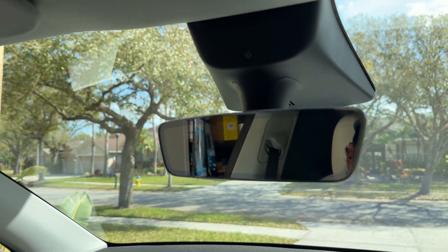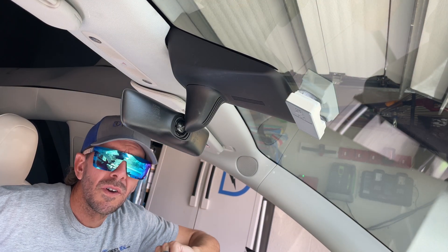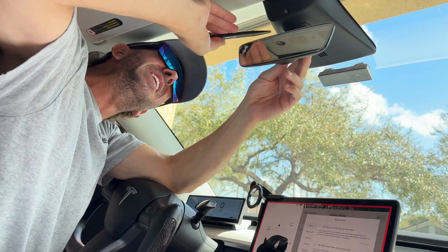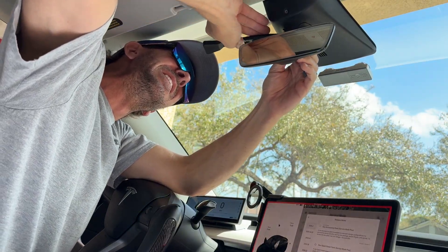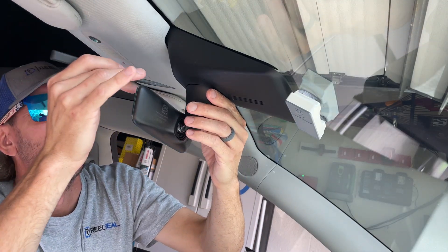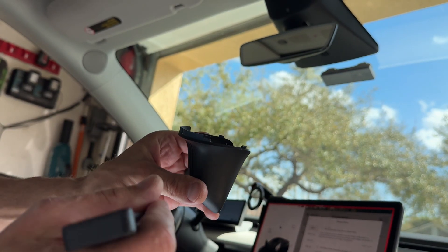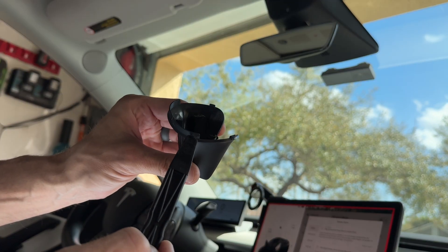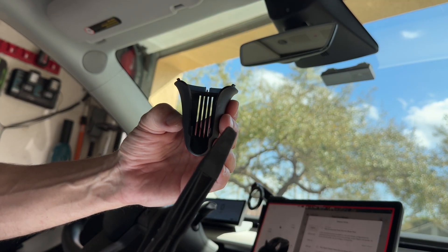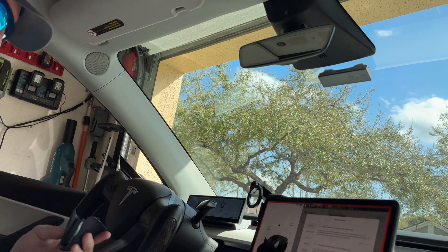This is the camera right here, so let's get that changed out. The first thing we want to do is remove this cover — you don't want to mar up the plastic, so just use a plastic pry tool and pull it down. These are the clips you have: one here, here, here, and here — total of four — and down here is just a guide so it slides right in. You pull this straight down using the pry tool to get in there and push it down.